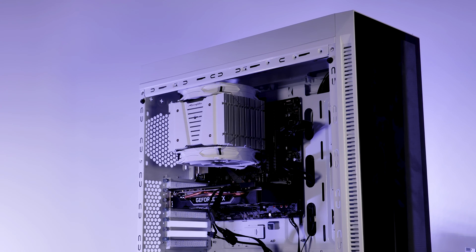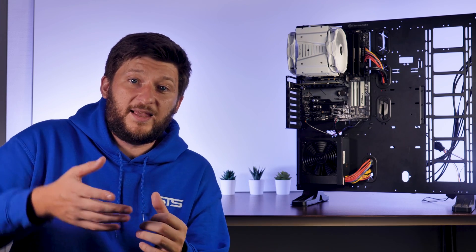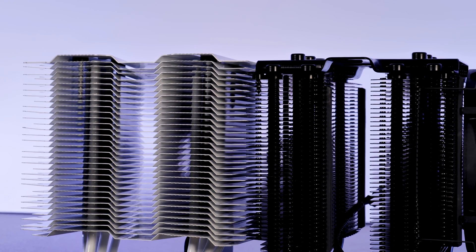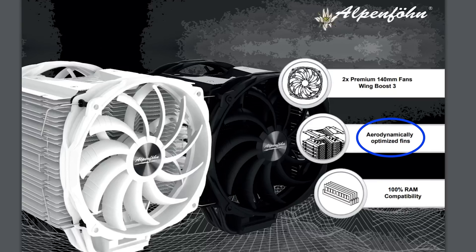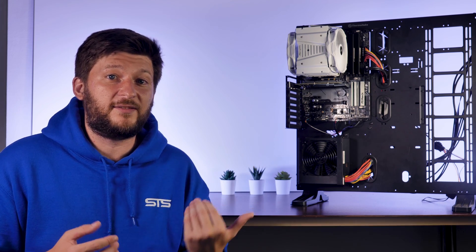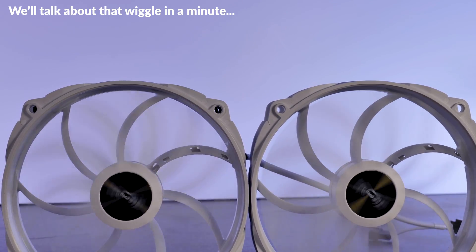The top and bottom installations also have their benefits. Pivoting to the top gives you enough space between the cooler and the GPU to suck all of the air from the center of the case and blast it out at the top. All of that is just one hell of a thought-through product. Another point that intrigued me was the design of the heatsink fins. Most coolers have straight fins stacked closely together, but the Brocken went with what they call aerodynamically optimized fins — surprisingly spread apart. This reminded me of Noctua's passive CPU cooler, the NH-P1, leading me to believe the heatsink itself already has pretty good passive heat dissipation properties — strengthened by the fact the included fans only spin at around 1000 RPM.